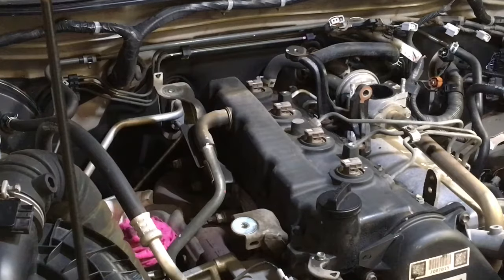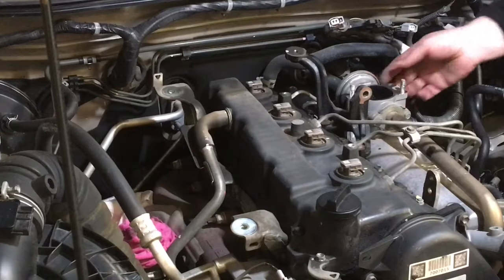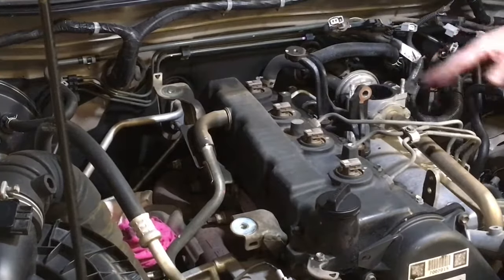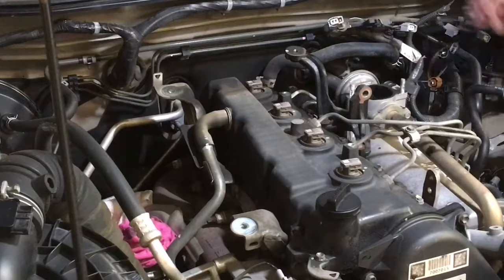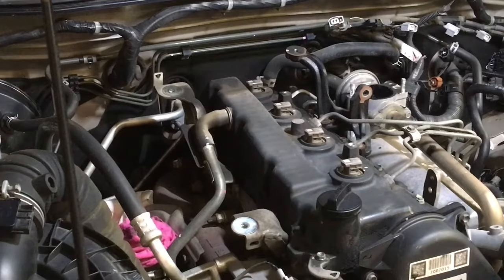Still got to be cleaned anyway, but so this is the EGR valve, which on the other car probably wouldn't even be the same part. I haven't ever taken notice of it. I think it's probably different actually, the other one sits up here on the Euro 4. So this is a bit laid down and different, and this is not too bad, I can tell you, but all the oil is washing it through as well, which is why we lock the plate to reduce the soot and let the oil go through. It just kind of washes it and keeps it clean. You've seen on the other videos how well it works.